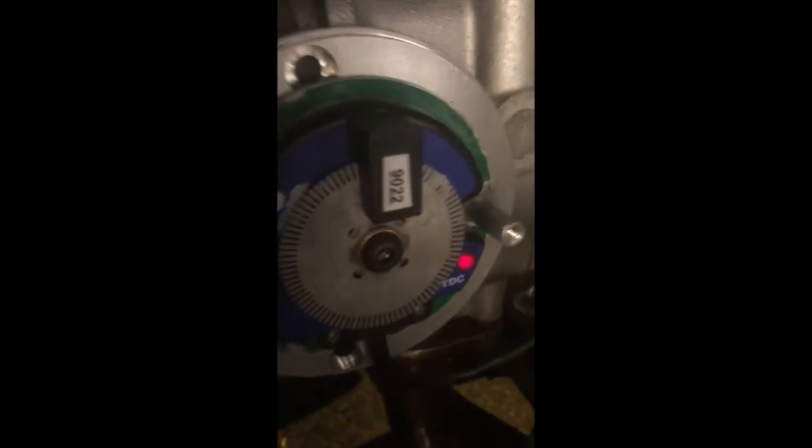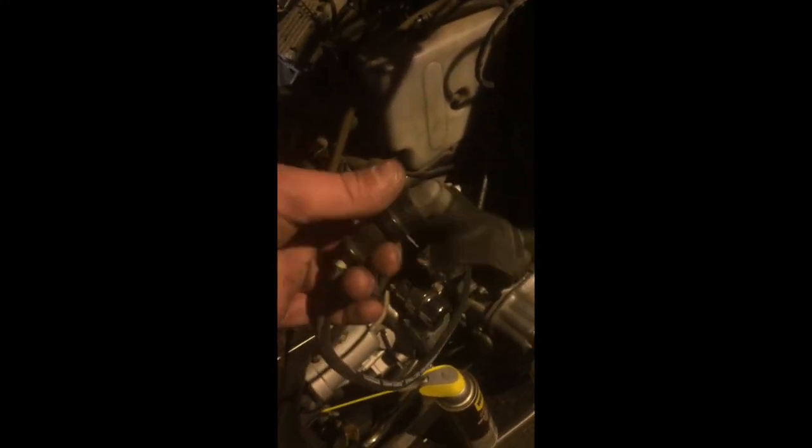I just switched the power on and I got this little red LED light coming on. I tightened it — I had to back it off a little bit, then tighten it until it presented with that little bright LED light. So all my wiring is correct. I had to actually cut off the top of the old one, strip the outer black coating off the white wire, and just screw this in there because it has a little screw in there — so we can go ahead and just push this in.